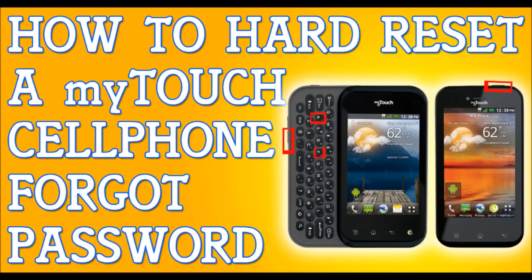Please note that if you see the Android shooting up, then the reset didn't work and you're going to have to restart and do it again. For a quick recap: press and hold the volume down key, the F key, and the A key — these three buttons — then hold down the power button until you see the LG logo, then let go of the power button. Continue to hold the three buttons until you see the logo flash, let go, and then the Android unpacking screen will unpack your software and reset itself — that fast, that simple.